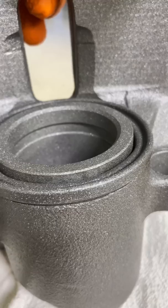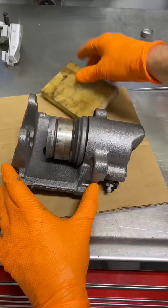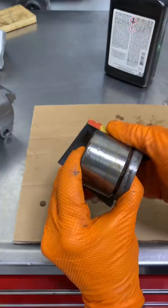I now have to remove the piston to replace all the seals. I use shop air to push the piston out and a block of wood to protect the piston. I get it all out, clean it up, pull out all the seals, polish the piston, put it all back together, and it is a great looking caliper.